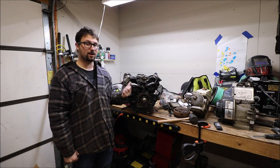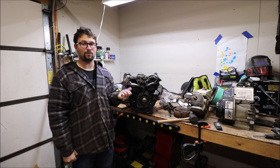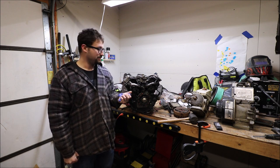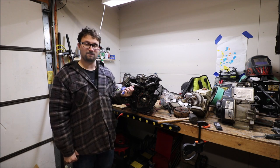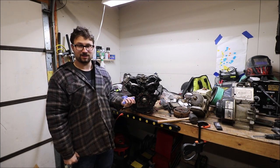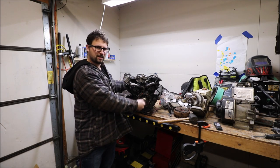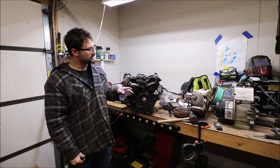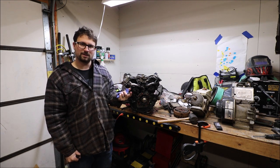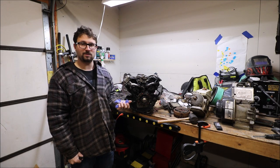In this video, we're going to be tearing apart this 18 horsepower Briggs to try to figure out what went wrong, and perhaps we can find parts for it and rebuild it, because it's still a very expensive engine and it's a shame that it's having the issues that it's having. I mean, if you guys remember, it was kind of a knocking noise, the crankshaft was loose. I'm kind of curious if on one of these pistons on the bottom, if the bearings are worn out. We might be able to replace that and fix it. So we should open it up and take a peek.